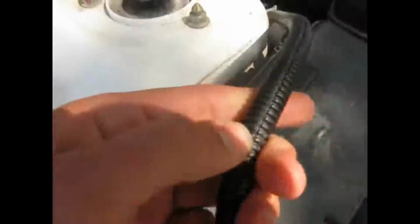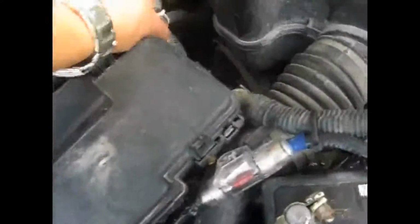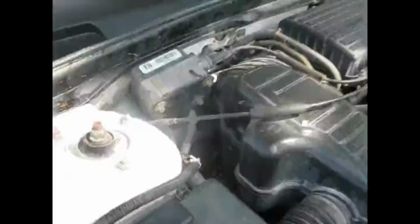The wire itself is 4 gauge. I've got it covered with just this plastic cover here. You can get this from pretty much any auto shop or even any electronic shop. It's just a useful heat protector so you don't melt your wire to something. Really useful. So it runs through the firewall through a little grommet in there, and comes out on the driver's side underneath the floor. I don't know if I can see it or not. I don't think so. It comes all the way down underneath the floor and underneath this trim here. It's all strapped in so we don't accidentally short it again.